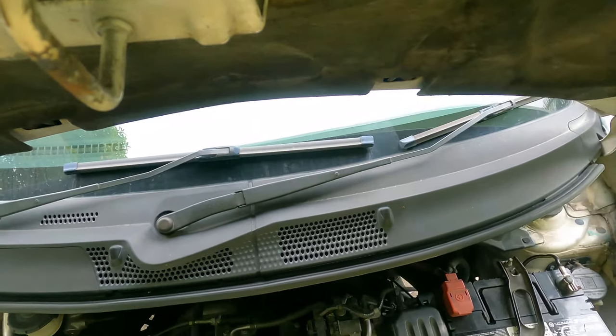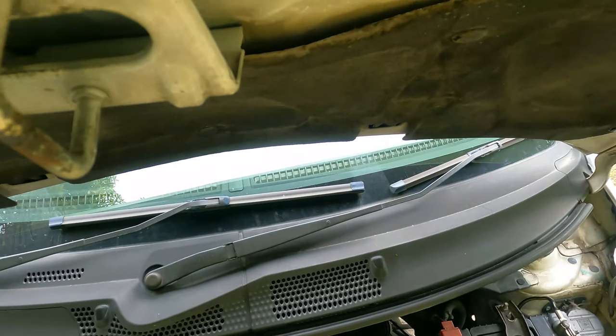It's very important - I actually forgot - the reservoir for the master cylinder needs to actually be opened to atmosphere. It's open. Should have done this from the very beginning. Kind of tricky doing this one-handed. What's going to happen is this should be open to atmosphere for the purpose of allowing air to come up and out when we squeeze the master cylinder piston in.